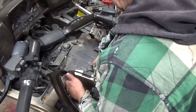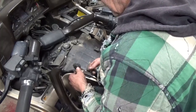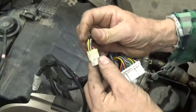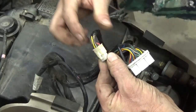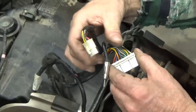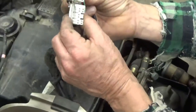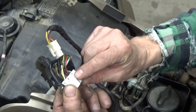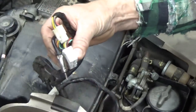The subwoofer install will be another video — this was all about three or four years ago when I bought the bike, before I started doing videos. In case you're having trouble figuring out how to get these wires off the radio: this little one has a push tab on top that releases it, the antenna just unplugs, and these two white connectors are two different sizes so you don't have to worry about mixing them up. They've got a recessed push tab that you push in to unlock them so you can pull them out.